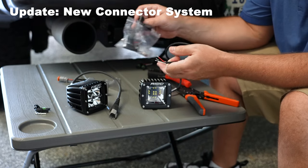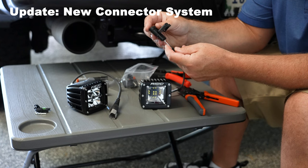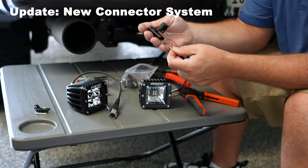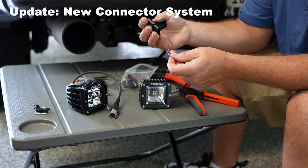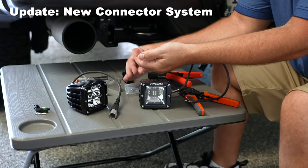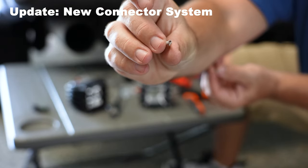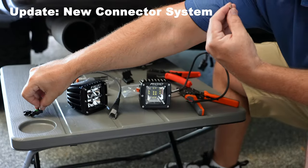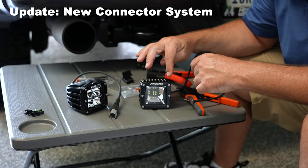What you need are connectors, and we provide those with our Universal Harness kit. You're just going to put the pins on and the connector on your existing light, so you always have a waterproof connector on your lights regardless. Whether or not the light came with a connector, we're going to have an adapter that fits. If it didn't come with a connector, we supply you with a set of connectors that match up to the harness — you simply put the pins on and slide the connector on. Now, pay close attention because there are two different style pins that come with the kits. One pin has a hole in the middle — it's a tube. That is the pin that goes with the single connectors for your switch wires. Put those aside because you don't want to put the wrong pins in these connectors, or they won't plug in correctly to your harness.